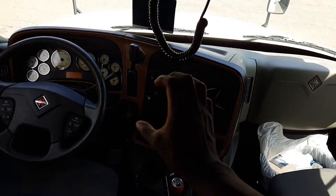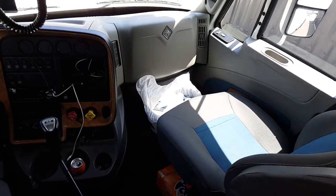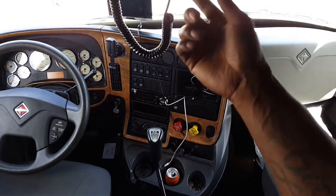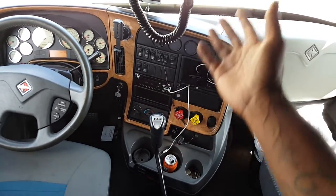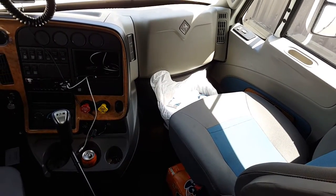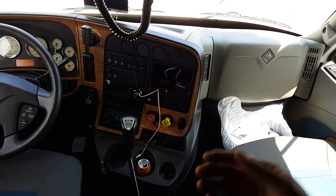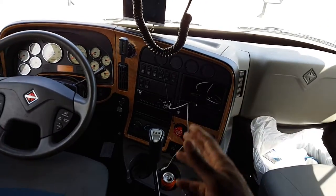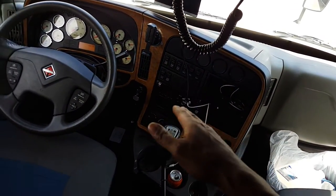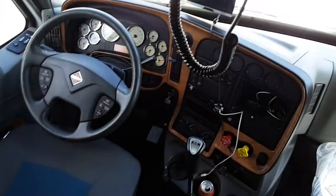What I did was order a single-DIN Android unit — it's a seven-inch motorized screen with Android. The soundbar speakers have Bluetooth, so instead of using the truck speakers I can Bluetooth the audio from the radio back to the soundbar and subwoofer, and it sounds way better. Instead of getting it customized with an amp and a box, I'll just Bluetooth the audio back there. The current unit only allows Bluetooth out but not Bluetooth audio in, so this is the solution. Anyway, thanks for watching — see you guys later.